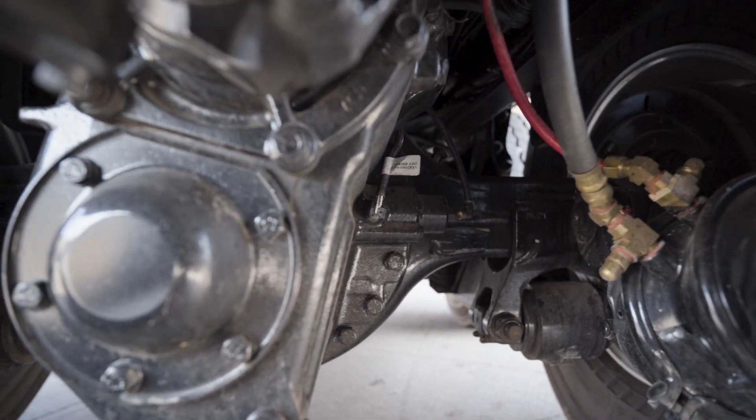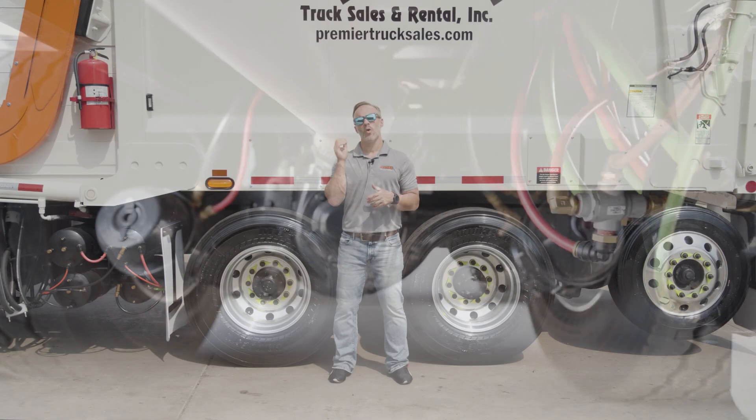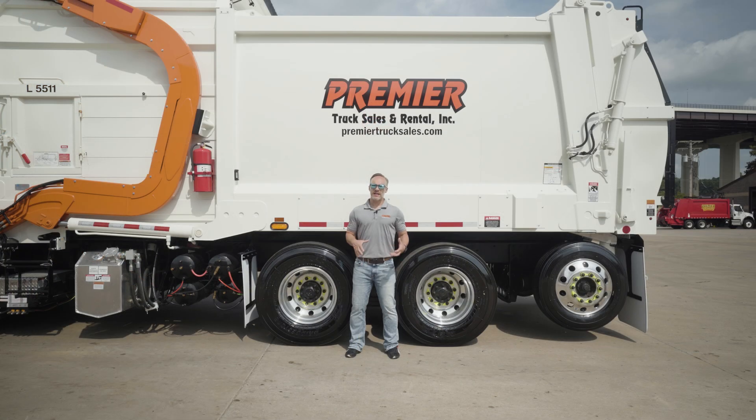The lockers, the bearings, the gears, the axle shafts — those are all stuffed in Meritor 46-160 housings. That gives you that 46,000 pound capacity to make sure we're going to stay legal all the way up to that 79,500 pounds. On the ends of those Meritor housings, we've got Accuride aluminum wheels again — not only for the look, but it's that weight savings that we're going for.